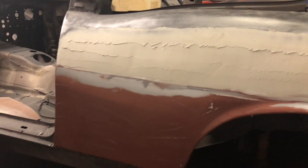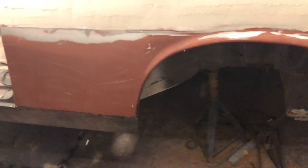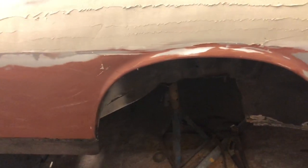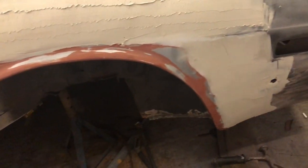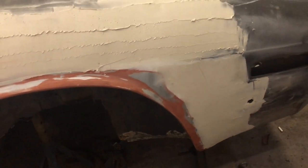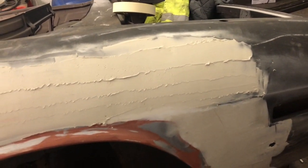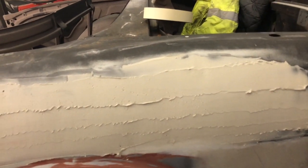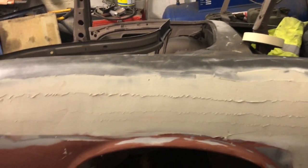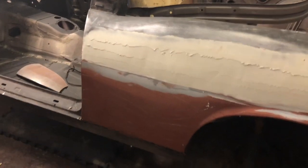I'm happy enough with my rear quarter panel that I made. So that's all feathered in quite well, it's got some dressing down on there. I've managed to get rid of most of the dent by pulling. You can see it's such a thin layer of feather - it's not the end at all really. It's going to need a bit more just here.